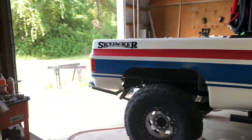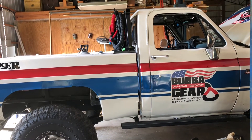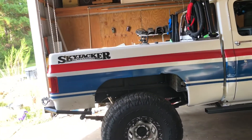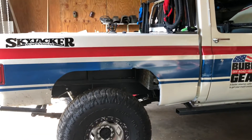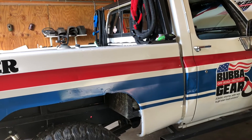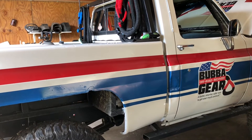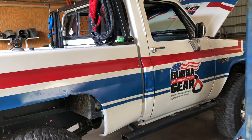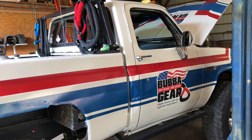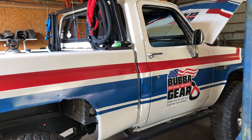I've seen too many electric fan failures, and you're just SOL when they fail. People say, 'Yeah, but just carry a spare motor' — well, that's something else you've got to carry. And let's say your electrical system has an issue, say your alternator quits. An electric fan pulls a lot of power — how far are you going to get with no electrical power trying to cool the engine, while running everything else that needs to go? Everything we've got now has electric fuel pumps, computers, and everything else running it. Just a couple things to think about.